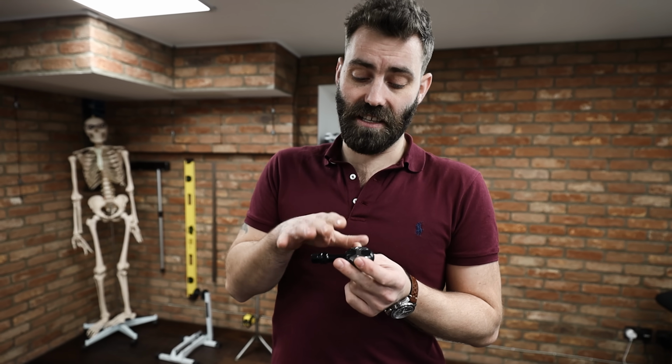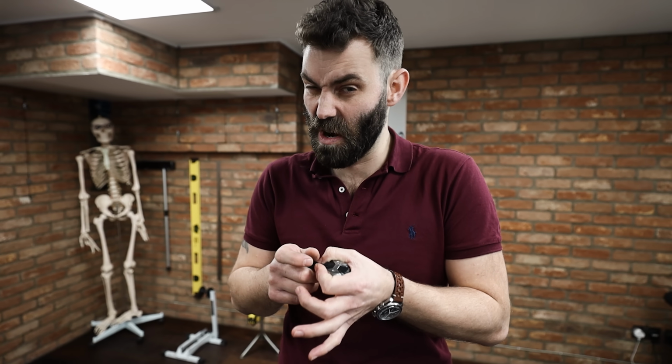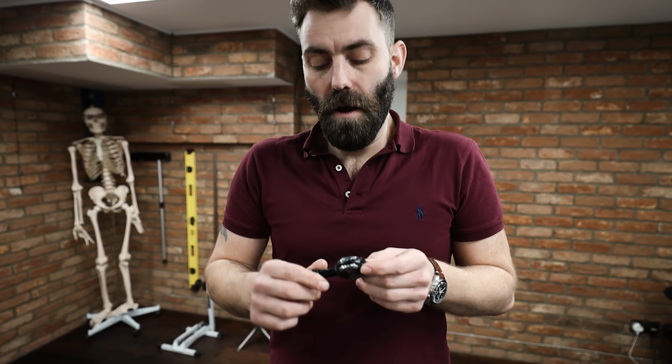Actually, the lack of stability tends to come from the C-spring that retains the cleat on the pedal wearing at quite an alarming rate, usually within 1,000 miles or so, which means that the pedal tends to develop rock. So with larger riders, it tends not to be a great system.